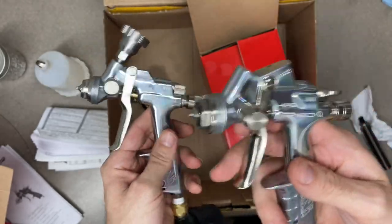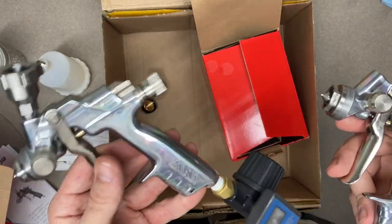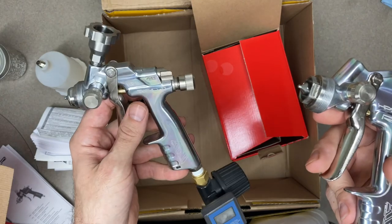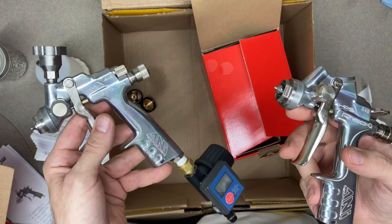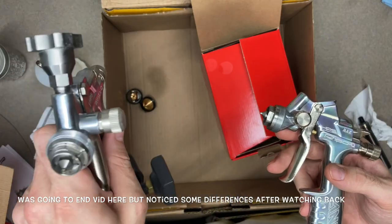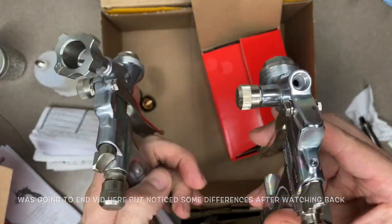I probably won't have anything to clear coat for a little while, but I'm gonna make this R160 my new dedicated clear gun. The R150 was my dedicated clear gun before, and I was using my Iwata LPH80 for paint. I do use water-based paint and the R150 puts down a lot more paint than the Iwata LPH80, so I want something a little bigger for laying down base coats with my Createx water-based paint. So the R160 will be my clear gun, and this one will be for water-based paints.